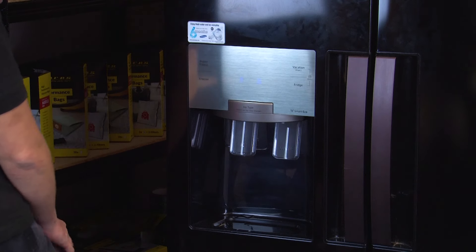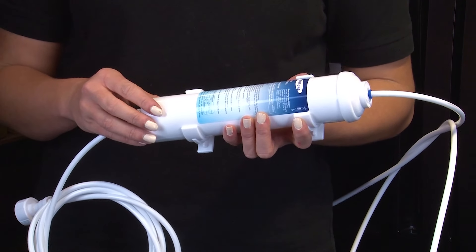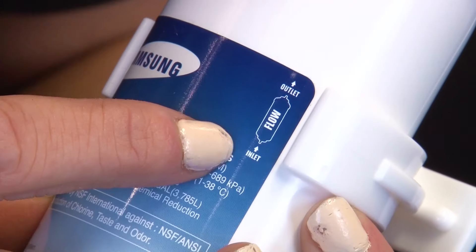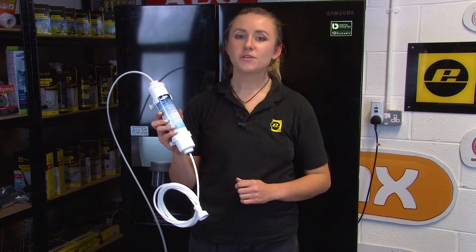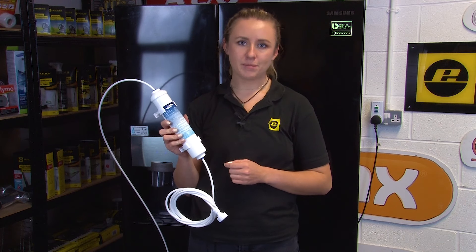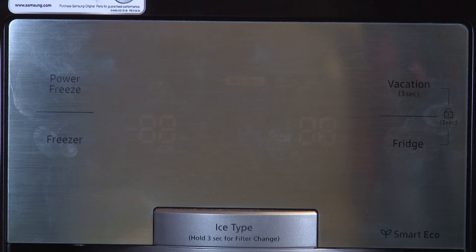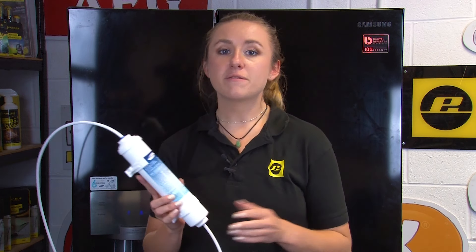The next check is to ensure that the water filter is properly fixed — the arrow for water flow on the filter should be pointing towards the fridge. The water filter on your fridge freezer makes sure that your water is clean and free from contaminants, and to make sure this doesn't get blocked you should replace it every six months. The display screen on your fridge freezer should alert you when the filter needs replacing by the filter icon turning red. If you suspect that your water filter has become blocked or damaged, it's best just to replace it. If you are in need of a replacement, we'll link down below in the description, but you will need to know your appliance's model number — you can refer back to the video we linked earlier in this video.